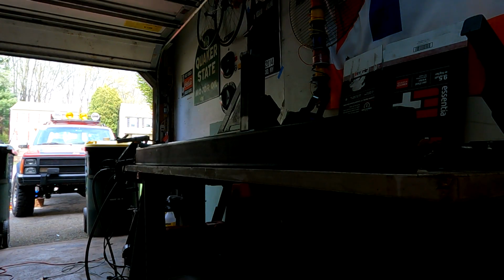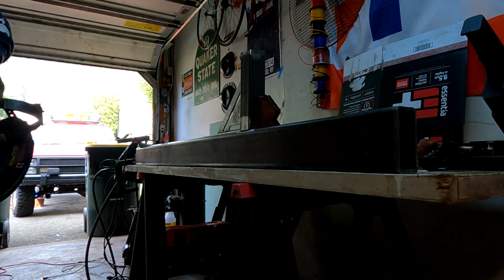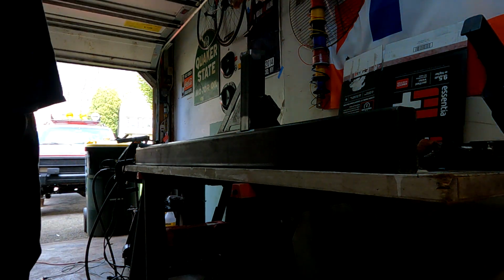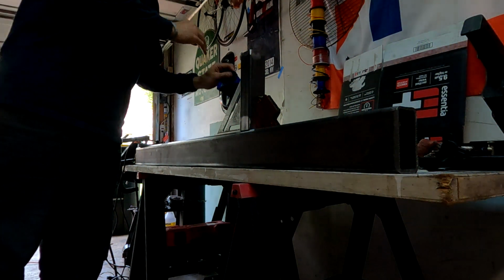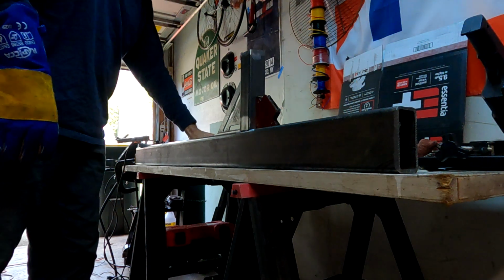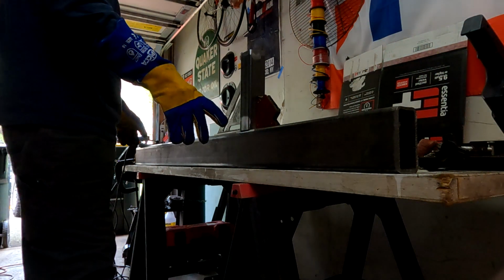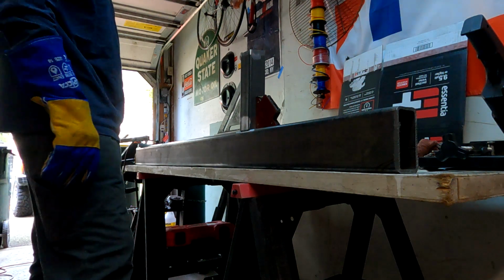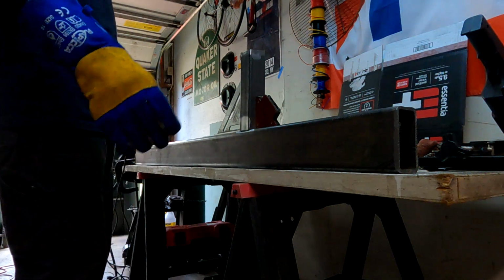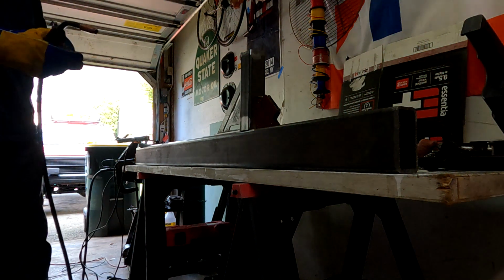Now the fun part, get the weld. So let's get to it. This time I'll have to weld upside down. Hate doing that. We're just gonna tack it into place. We're not gonna finish weld it. I wanna tack both in, and then put the plates on, and then we'll dry fit it. And if it's good, we're going to move on to something else, non-Jeep related, and finish welding it up tonight. All right.